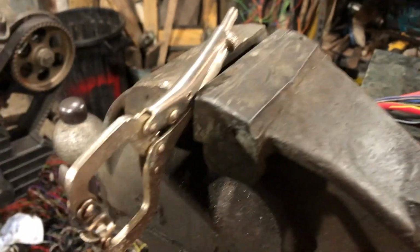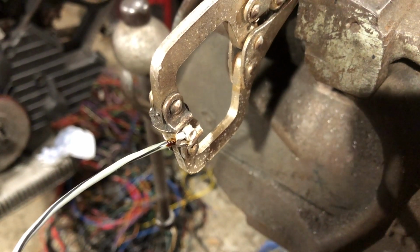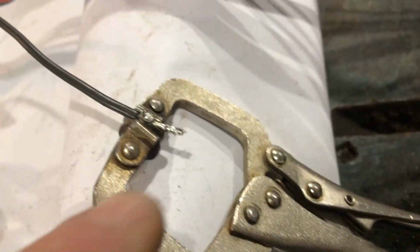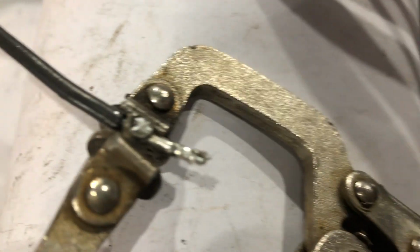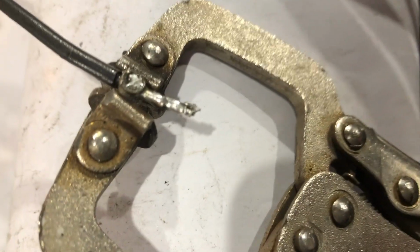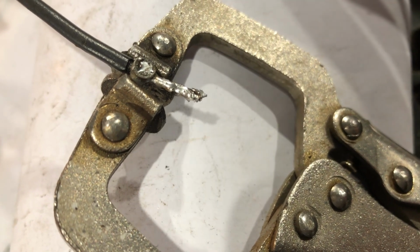The wire came out of the plug, so I think I can clean that up now. Ooh. Put the thicker wire in. The job should be a good one. So I tinned the end of the wire, and then heated it up, and then took the heat gun away and pushed the wire through the hole, and then topped the bit on the top up with a normal solder. I think that might be alright, we'll see.